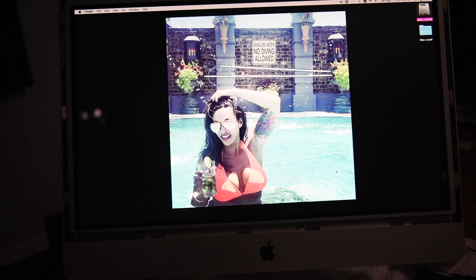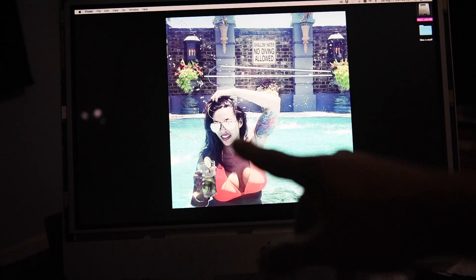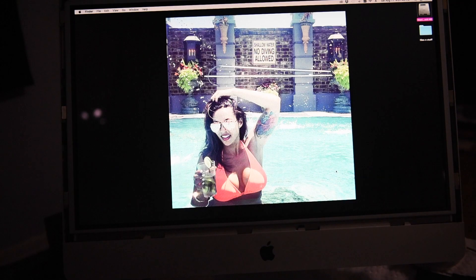Here's what I did: I took the computer apart, and the first thing I noticed was that there was a lot of dust accumulated over the years in there. It was pretty dusty all around the heat sink and the fans were coated in dust. So I took a little brush, cleaned everything off, got it all nice and neat, put it back together, and it worked for about a month.